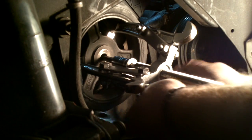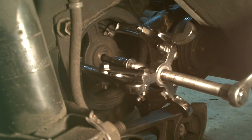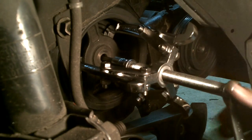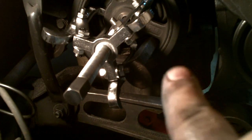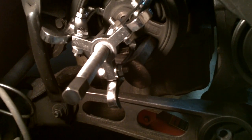Make sure all my connecting points are tight so there's no slack for something to shift and shear. Just crank on it and it'll break free. I had to put the railroad spike back in because once I got a certain amount of pressure on it, the pulley wanted to spin past the arm. Stuck the bar back in there so it won't spin. And it popped right off.